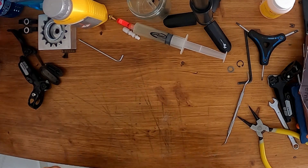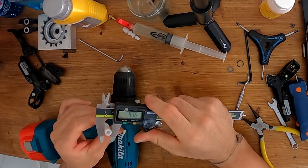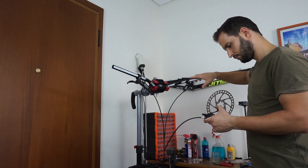I immediately thought that I could modify the diameter of these spots and then order new pistons, getting working brakes to finish my bike build in the meantime. So I used my drill as a lathe to symmetrically shave down a tenth of a millimeter and get my brakes working properly again. After assembling everything back together — which was also quite tricky — I was so surprised that this worked out perfectly and my levers now feel as good as new. After going online to search for replacement pistons I saw that this is a well-known issue for these brakes, and I was happy to find another video that does exactly the same modification to save the existing pistons and make the levers functional again. I'll have the link to that video in the description below.